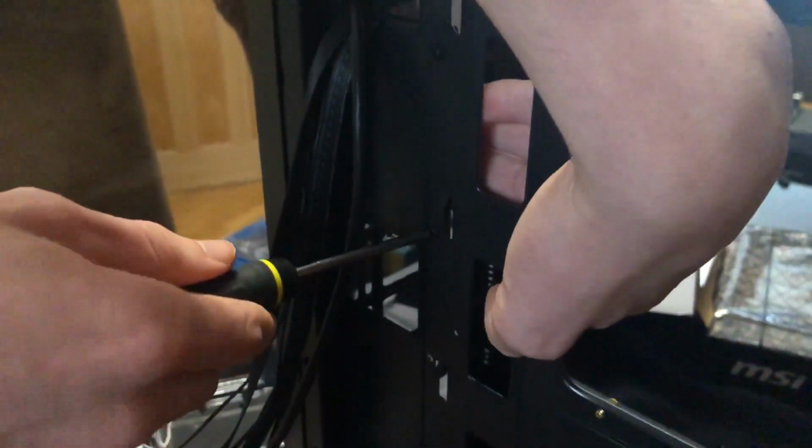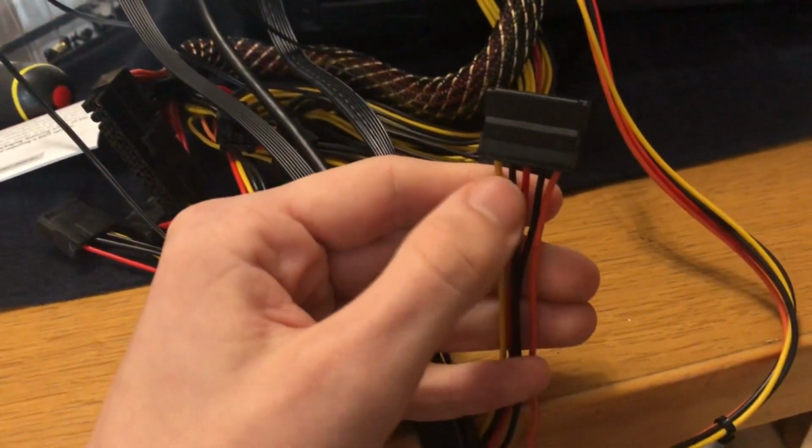So just 2 screws there. It goes in the top right. You can put it in the one below as well because you can see there was 2 marked out SSD drives there, and that is going to plug in later onto the SATA cable that you can see here, just so you get the right cable. And then we were able to put that side back on once the SSD was in. Once you've got your drive in, that's all you need to do on that side.